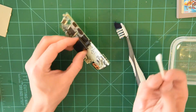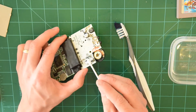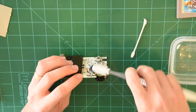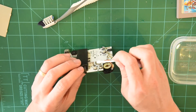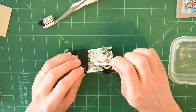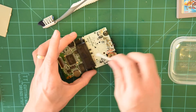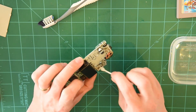Now with these battery terminals in the board, this is where we're going to use our Q-tip. You can see there's just a little bit of corrosion right in here, and I'm wondering if that is what's disrupting the connection. So we're going to dip our Q-tip in some vinegar — and you can see, once again, it immediately starts bubbling up and going away. You can scrub it again with your toothbrush if it needs a little bit of mechanical force to get that corrosion off. Just let it simmer for a little bit and soak like dishes in the sink — it's just going to chip away at that corrosion. The vinegar is not going to hurt the system if it gets elsewhere on the board. In fact, with some projects we're going to have to use a lot more vinegar on the whole system.